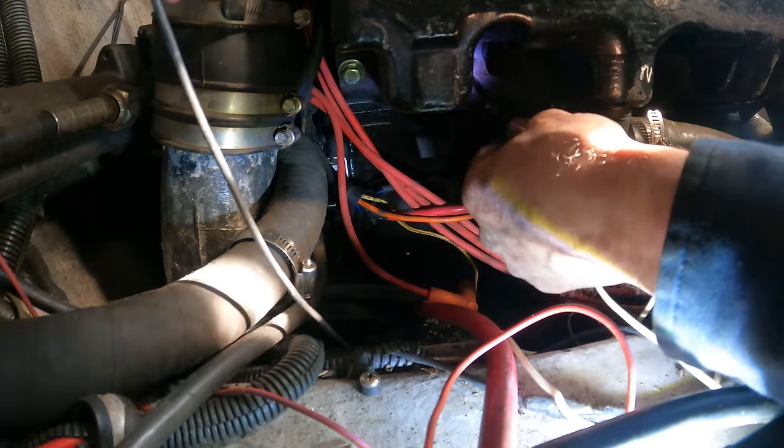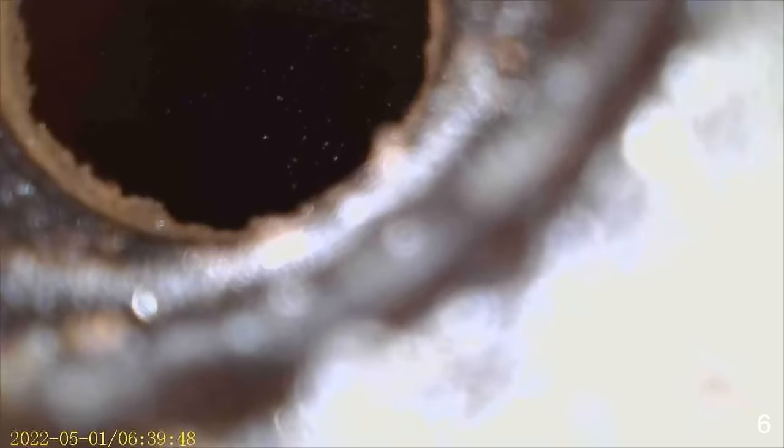Let's take a look. So this is cylinder number 8, and you can immediately see lots of rust on the cylinder walls, and that's water sitting right there. That is down. The scope is not oriented up to down. And it looks like a lot of rust from condensation on the top and bottom of the cylinder wall. Next, we're going to cylinder 6. This is the right side of the engine, so all the even numbered cylinders are over here. And you can again see that there has been a lot of water sitting in here, but much of it is gone. There's several water lines and then a whole bunch of rust sitting right at the bottom where the piston and the cylinder wall are down. That looks awful. This is one of the worst ones.